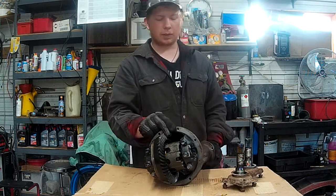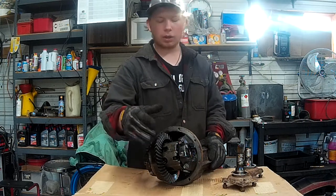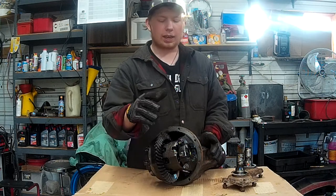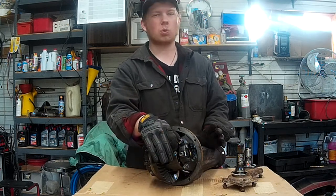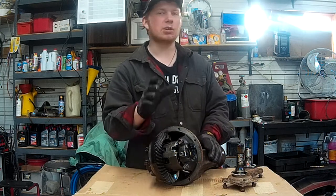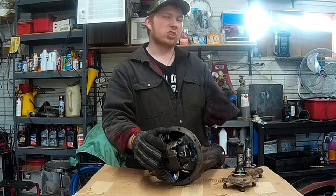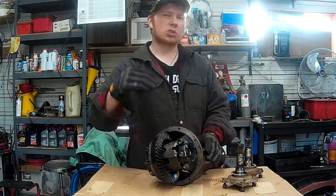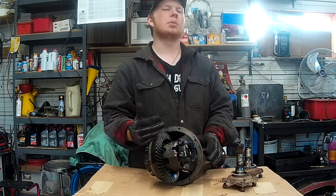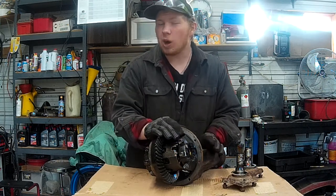The only problem with that is sometimes when you do a handbrake pull and then go to a clutch kick to get the rear wheel spinning, in that process of stop, go, I'm assuming they can get really hot, and they tend to not engage often. A system like this would be perfect and ideal for stuff like autocross, drag racing maybe, just race days at the track, so you get that maximum grip coming out of the corner, but that nice, predictable handling. Now, in a drift car, we don't really want that